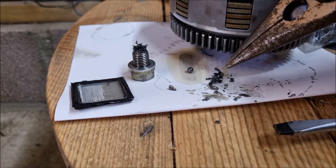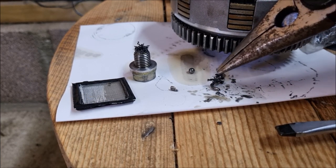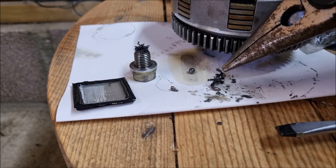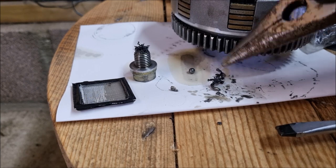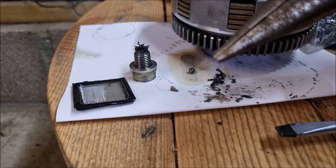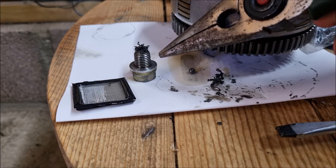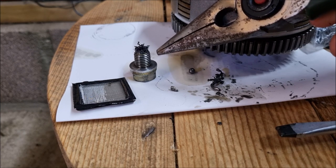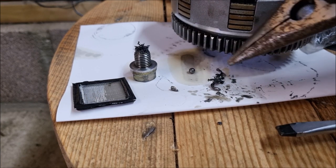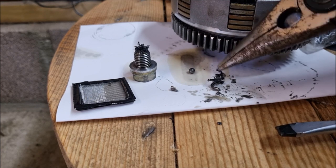Had a little think about it, and when I had this bike at the beginning, I had a valve go. The cam sprocket went, the bearings went. I can only assume that means that this has been in there quite a few years. But you would never have got it out without looking like this, because that sump plug bolt, the magnetic one, which has come in very handy, I must say, would never have been able to pull that down. So you're never going to know anything you got floating around in your engine until you actually split it.